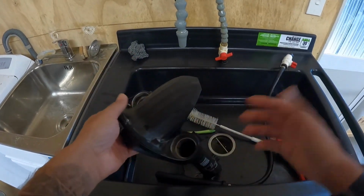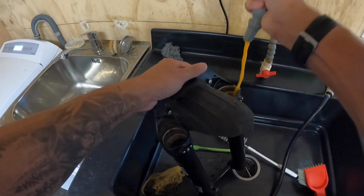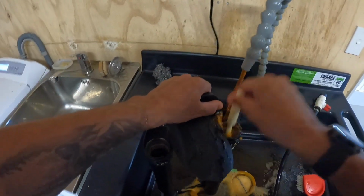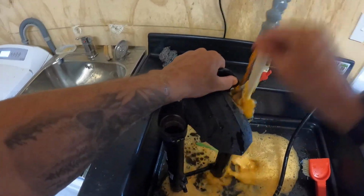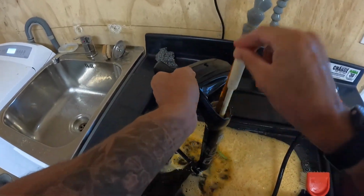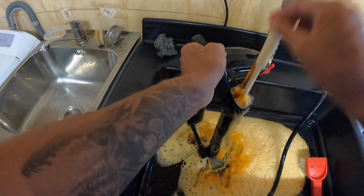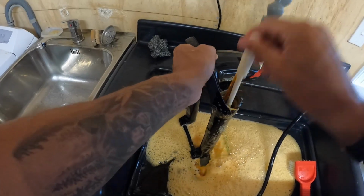Because we are obviously suspension technicians, we have an industrial parts washer, which makes it super easy to do this. And just like a toilet scrubbing brush, get all that crap, oil, grease, dirt, grit, everything you can out of there. Just go through, give everything a real good scrub. As I said, you can use isopropyl alcohol, you can use hot soapy water, just something to scrub and get rid of all of the old dirt and oil out of the lowers is the essential thing.